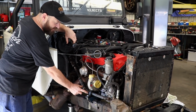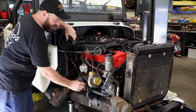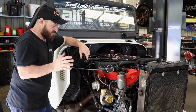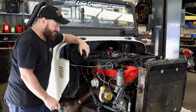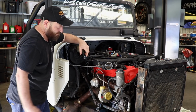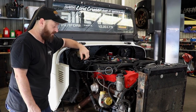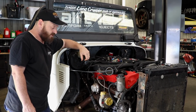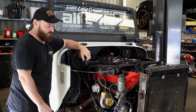We've got a double cardan here with 3/4 D bar that'll go through the middle of this plummer block. Then another shaft here. One of the shafts is collapsible because that's also required for accident stuff. That's what this crinkly bit here would have been for in the first place. Probably doesn't need to be, because if it does hit there, this thing will probably just pop out here somewhere, but them's the rules. We have to abide by them, otherwise it won't get its ticket to allow it to be on the road. So all that stuff's coming from the States because that's the best place to get it. It should be here very shortly, and then we can replace all this with the legit road going version.